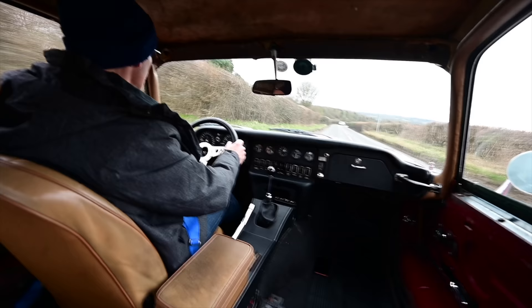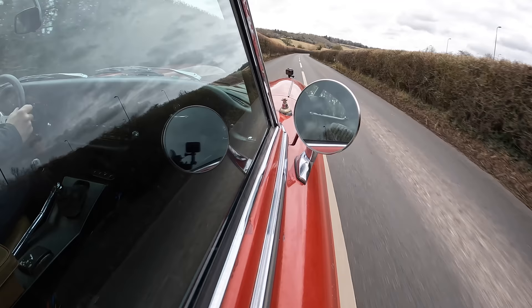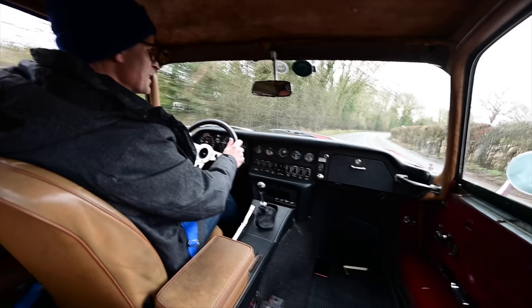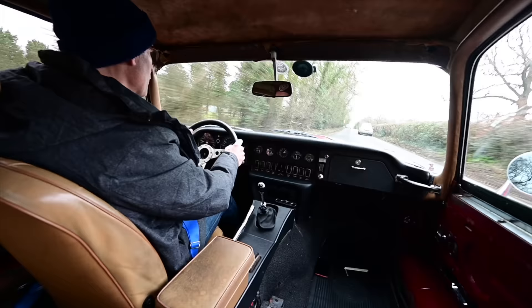It does get warm, obviously — it's a lot of engine in a tight space — so there's a much bigger radiator crammed in the nose. Fortunately, being a Series 3, it's got the bigger radiator grille to squeeze a bit more air in there. Twin electric fans do their best, and most of the time it's fine — we're currently sitting right in the middle where we should be. But in London traffic apparently it does get a bit dicey, sucking a bit too much power out of the alternator as well. It's still pretty much an ongoing project.